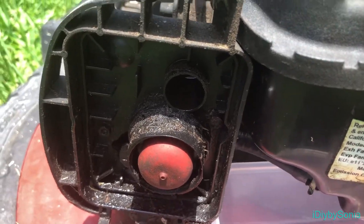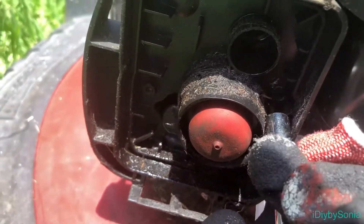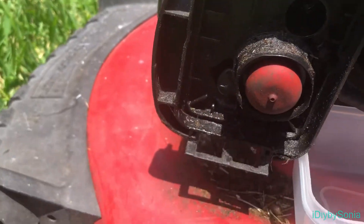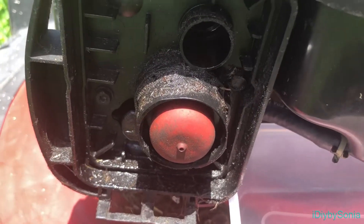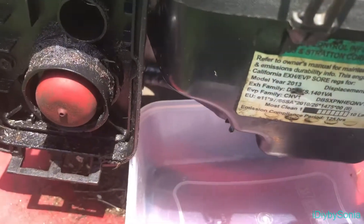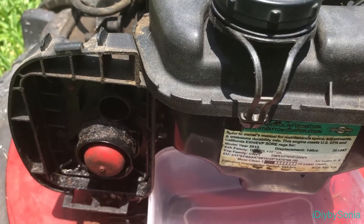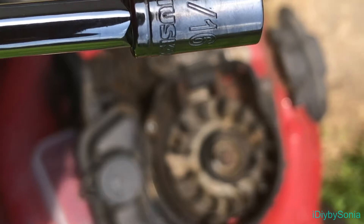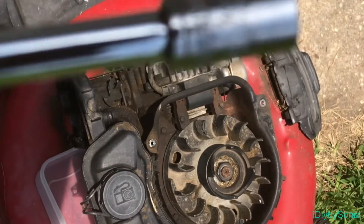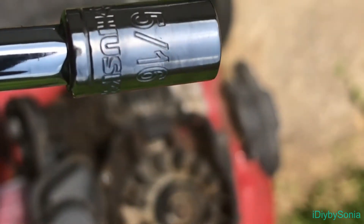If you can see, there's a bolt here on this side and a bolt here on this side that need to come down. I'll get the wrench and tools for that. I have a little container right here to catch anything that comes out as far as fuel. I do have fuel in here — I already mowed at least once this season so I know there's fuel in there. To remove those bolts I'm going to use a five-sixteenths of an inch socket. There it goes — five-sixteenths of an inch. That's being used to take that down.